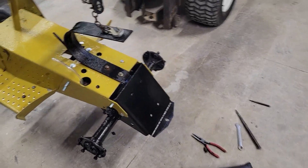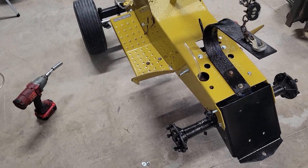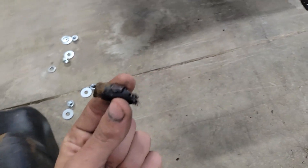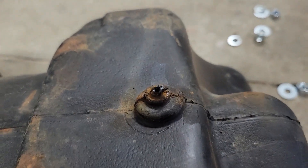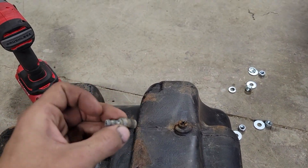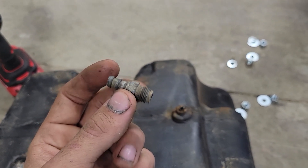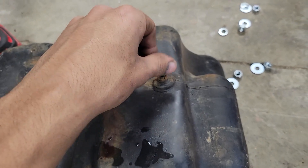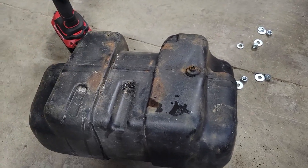This is the next day now. Back working on it. I got the transmission in — I didn't take any videos of it going in because I didn't feel like it. Getting ready to put the fuel tank on, then I went to pull off the remaining part of the old fuel line and I broke the plastic little stub that sticks out of the tank right off. My plan is I found this little metal piece — it's like for a carburetor, it screws into the carburetor. My plan is to drill this bigger, just the right size, and put some JB Weld on these threads and then thread that in there so the JB Weld will hold it in place.